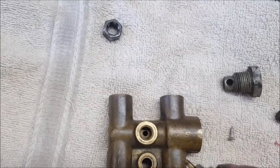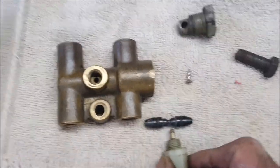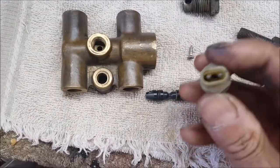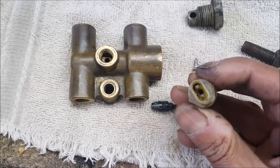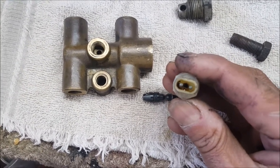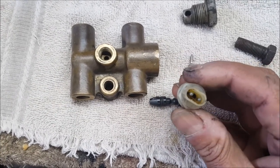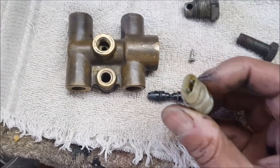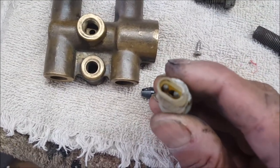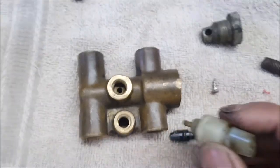As the shuttle moves, it presses the switch and makes contact. There are two contacts on this thing, and there's a little clip that connects the two. So when some people ask which way the connector goes, it doesn't really matter because if you look carefully there's a little bridge piece of metal that connects the two.